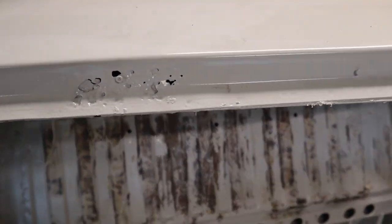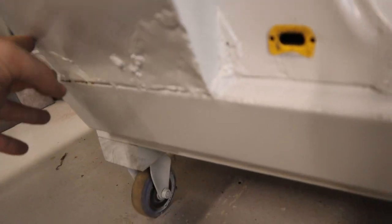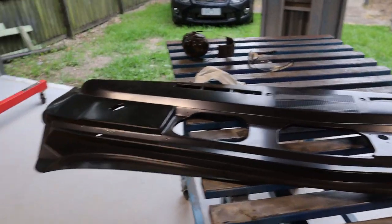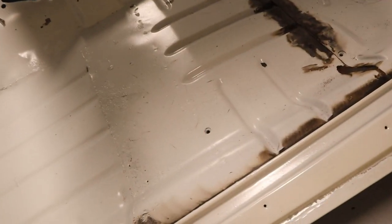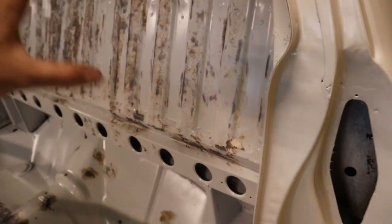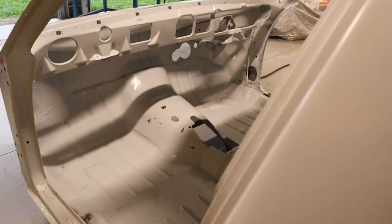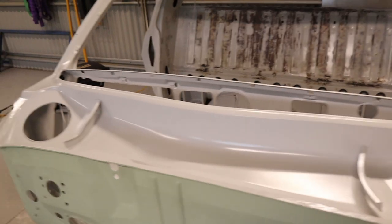Along the windscreen here, there's just that little area that will need cutting out — pretty straightforward. Same thing on this other side as well, dodgy repairs that I'll have to cut out and weld a new piece in. I'm going to weld this cowl back on. And then I'm also going to have to seam seal up everything. I've taken all the old seam sealer out — the sandblaster didn't get all of it. There was also a heap of glue left behind that the sandblaster didn't get, so I just wire wheeled all that off. Got some little body filler repairs like dents here, and I'm going to put body filler all over this section. Just going to get it all ready to give it one final coat of epoxy, and then I shouldn't have to open it up ever again.